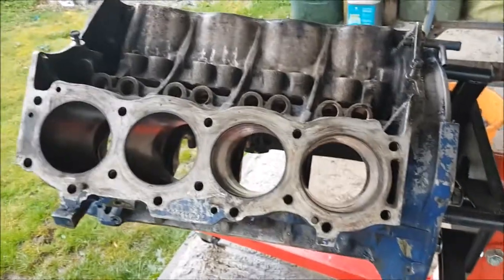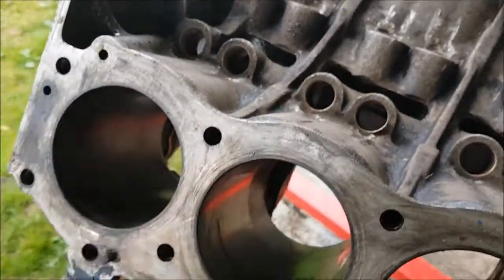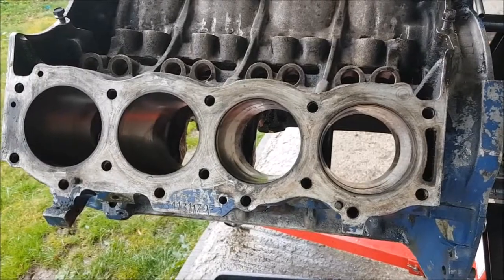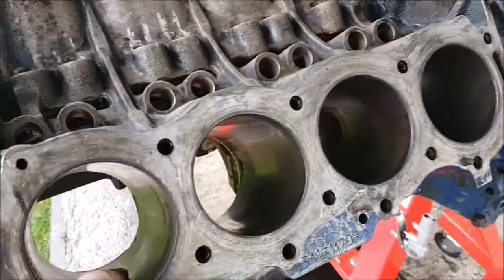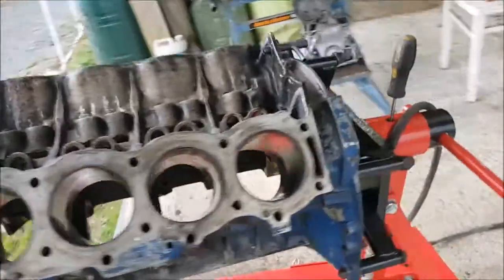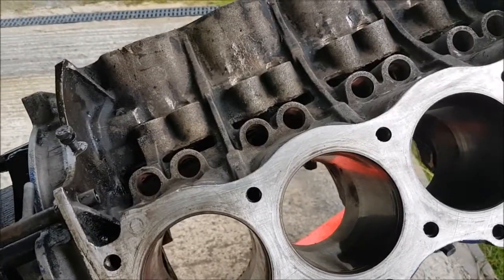I think what I need to do is take this back to my engine workshop chappy. There's glue on here by the way - someone's actually glued a head gasket on. I don't know why, because the gaskets you would use on these would be copper. The next steps really are to take it to my engine man, get his realistic assessment on whether it is a viable runner or whether it's a coffee table. When it's all stripped down like this it's not too bad. I suspect it's going to be a light hone, a chemical dip, and the rest of the work will be on the crankshaft.